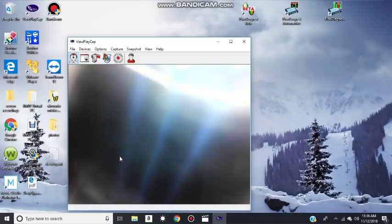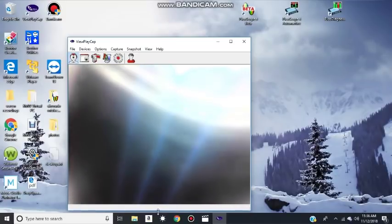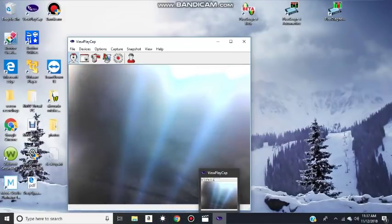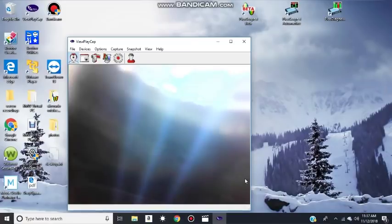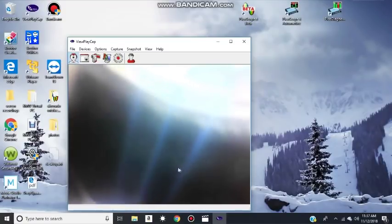Okay, so this is the stem. You can see the deposits on it as well, and this is towards the edge of the valve, and then we can see deposits on top of the valve as well. So definitely heavy carbon deposits, and that's what we see on our waveform. Now this is the exhaust valve. It's closed. There's another one here, so it's over here. Again, I'm sorry for such a bad picture.